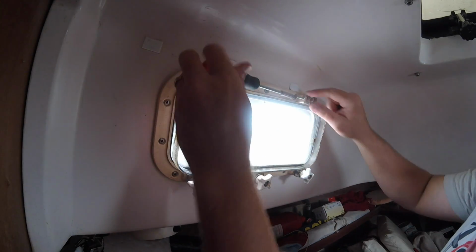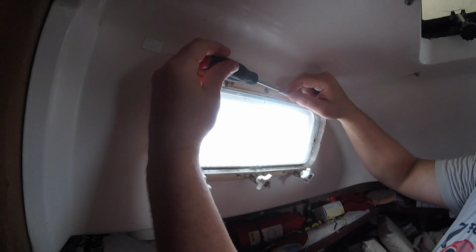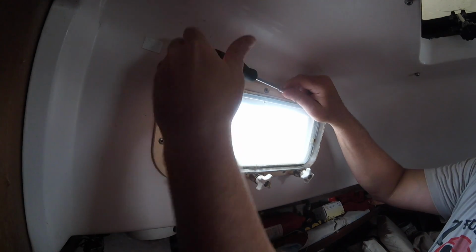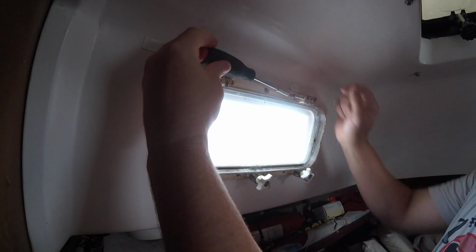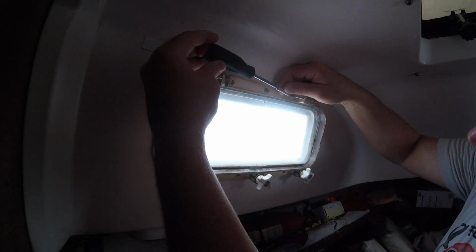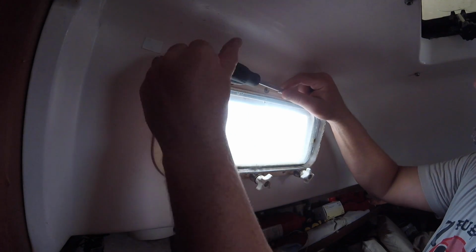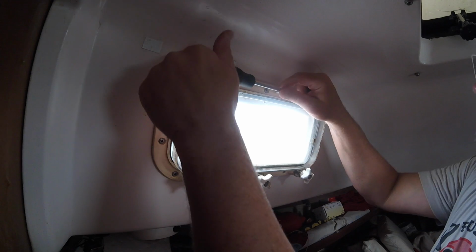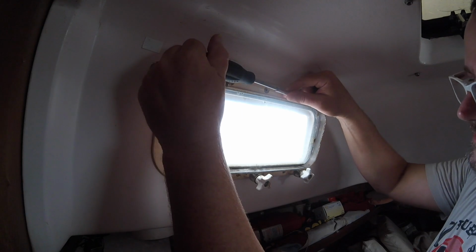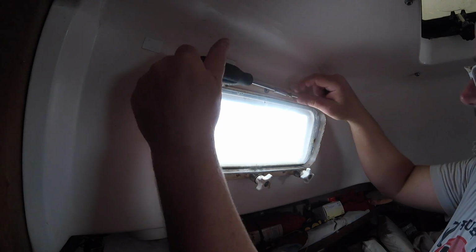Pull this right here, this last bit of unscrewing, and that is in there tough. But you've got to be very, very careful to not break the actual plastic bits that this is plugged into or screwed into, because they're so hard to replace. And replacing them means you actually have to peel them off the side and break the sealant, then reseal them. And this was done with some non-marine silicone, so it's really tough to get in there and break out.